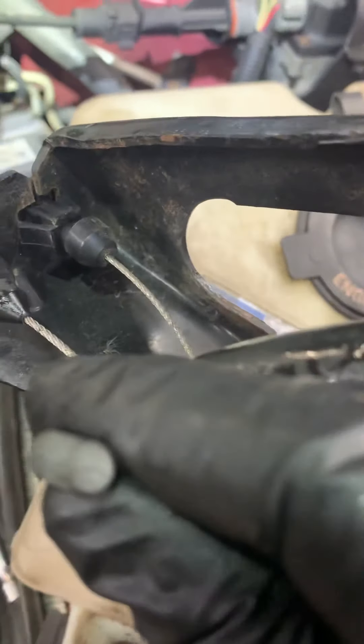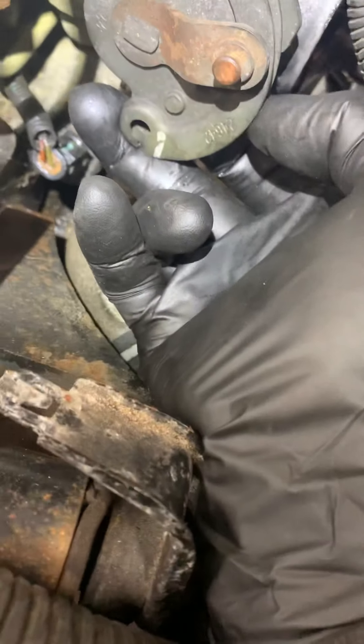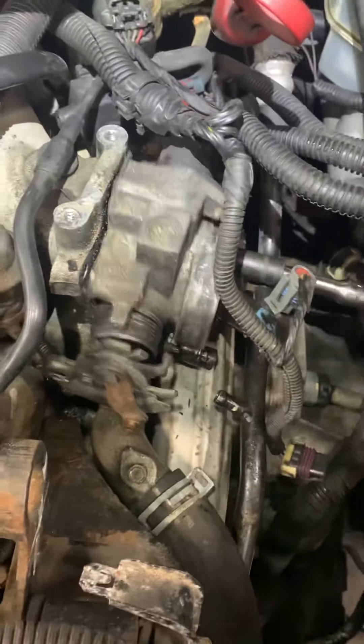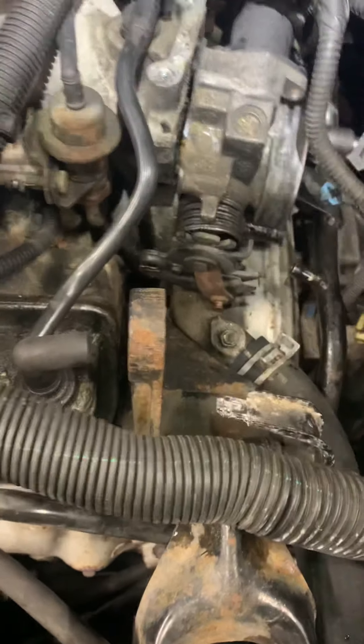It's just like a cable for a hood or anything else. Pull this forward like this, take the wire, sneak it out of that little gap right there — that's it. Get this throttle body off. You need a throttle body gasket when you do this — you guys do too, don't just buy a thermostat.